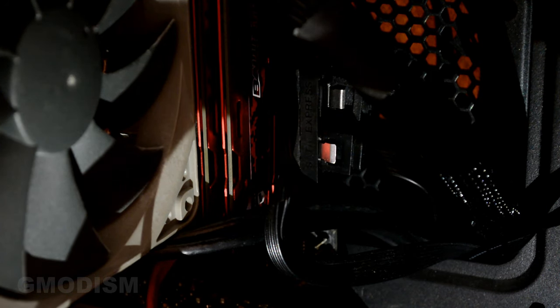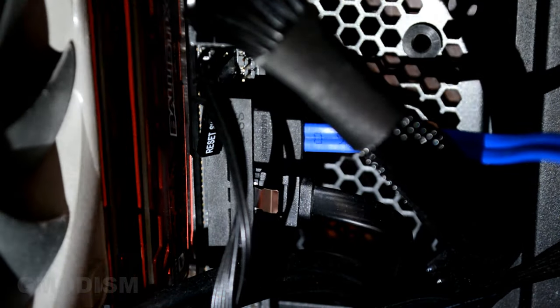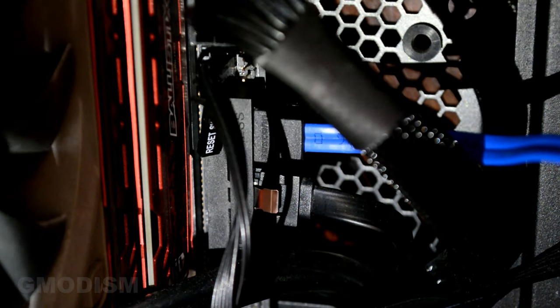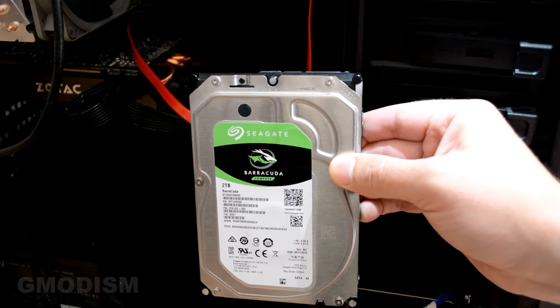If you put a hard drive to a SATA port that usually goes to a DVD, it will work fine. But it will be limited in speed, so you want to select the fastest SATA slots for hard drives, which is SATA 3 or SATA Express, which is present on basically all motherboards. Usually there is some kind of large SATA bus, like here. And there we have installed the SATA cable in the SATA Express or SATA 3 slot. Just read on the motherboard and you can see the SATA rating on the provided slot. And there we have our hard drive.